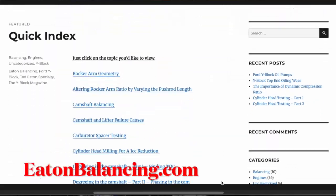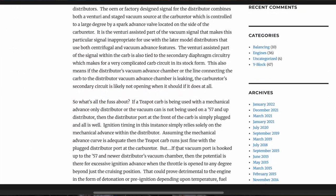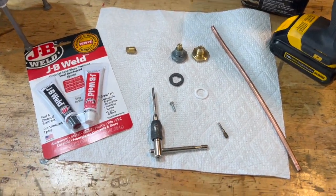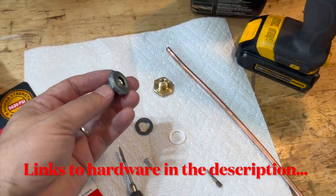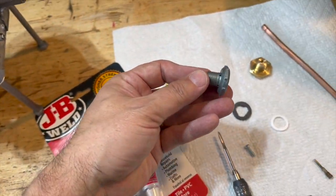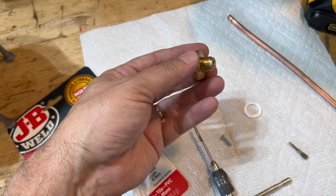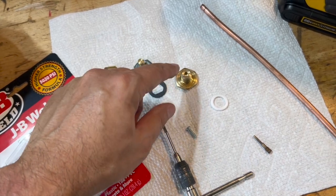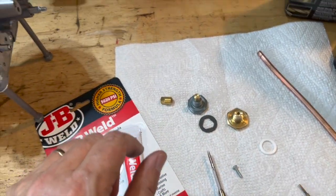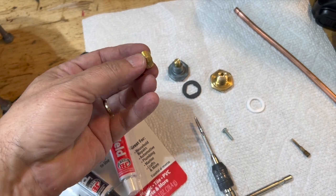So if we're going to get this one together, let's walk you through it. My friend Ted Eaton in Texas has a great article on his website about how to go about doing this. It's not that difficult to do. You're going to need, first of all, a power valve plug — this is the original power valve out of the kit from Daytona. What we're going to need to do is plug that port where the power valve is at. You also need a plug for your original vacuum line port. I think that's an eighth-inch NPT there.